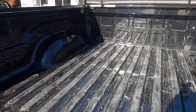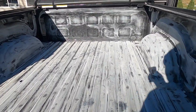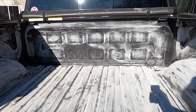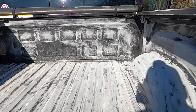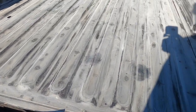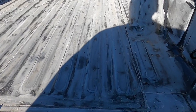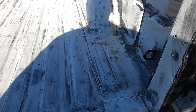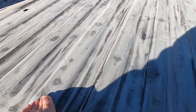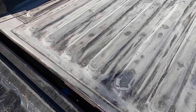Here's where we're at now. On the front of it I used the grillo pad and it did not perform that well — it got clogged up rather quickly and stopped scratching. So the 150 sandpaper really did the trick, again using the power sander. I got probably 90% of it done. I'm going to go back over the corners with the sandpaper, but not with the sander. It looks really white right now, but once cleaned up it'll probably turn black again. It's not all the way through the clear coat but good enough to hopefully get a good bite.